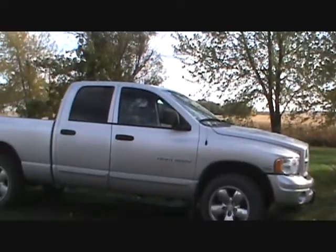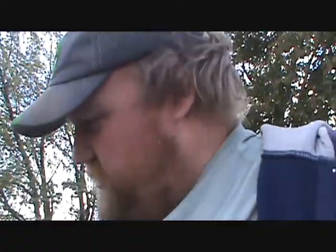But this truck here, it's my buddy's truck that we used to go get that truck when it died. And we hooked up to his trailer after I fixed it, the second time we used his truck. Found out his plug in the back end, somebody must have worked on it and thought they had it together. When they put the locking thing in to keep the plug back, it's got a nice factory watertight plug set up on that Dodge. Well, they didn't have it in there, so when they pushed that lock in, it pushed off. And so we fixed that. Once we fixed that, trailer lights were good to go. Well, it was grounding through his truck, and since his don't have the rust on it, that ball grounded out right away. Well, now I've got it to where it is grounded through the plug plus the ball.